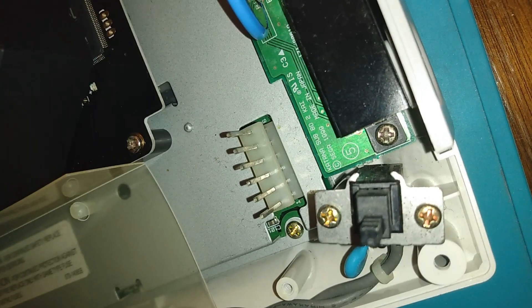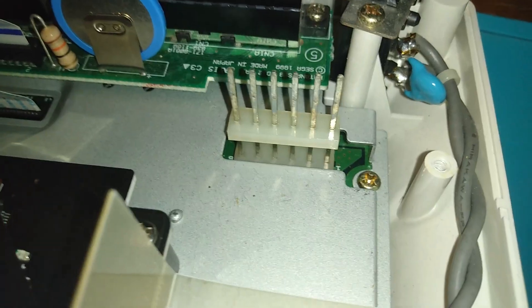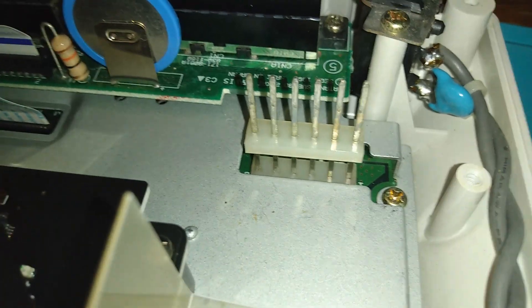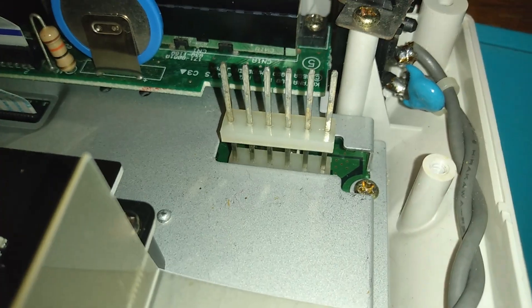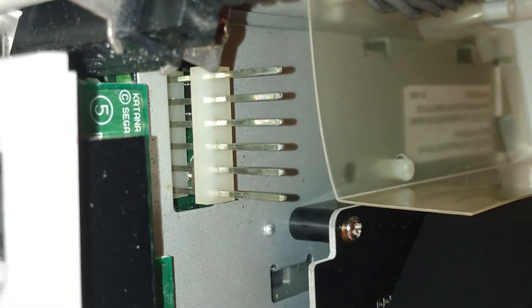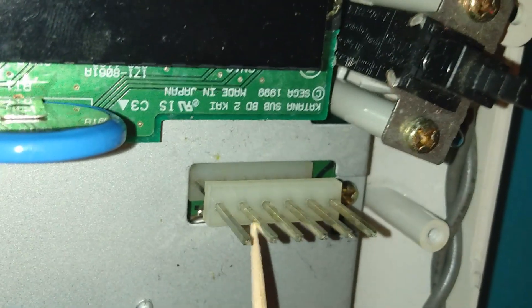And now it's out. Here are the pins that the power supply sockets onto, and it does look like a little bit of buildup and wear, mainly from the power supply sliding on and scraping against the surface of each pin. It did cause it to wear down a little bit and lost some of its coating. The front side of the pins look pretty clean from the left side of the console, and from the front, the pins look reasonably clean from the right side as well. But from the back side, it looks a little suspicious.